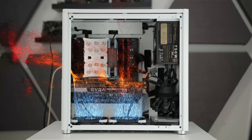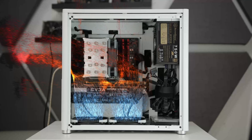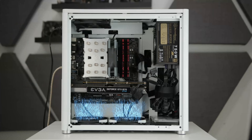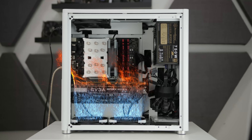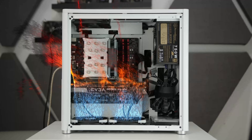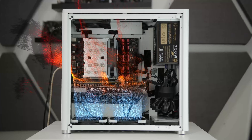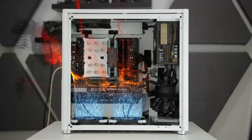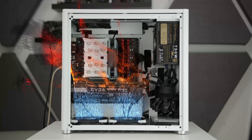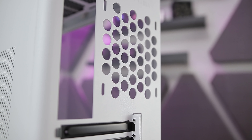I tested two different exhaust setups. The first was a rear exhaust working with the CPU cooler's fan and further assisting the graphics card. The second was placing the exhaust up top, which is perpendicular to the CPU cooler's fan and airflow, away from the graphics card, and exhausting through a fixed top panel filter — far from the free area afforded to the rear exhaust position. Just look at the size of those circular cutouts at the rear — loads of free area.